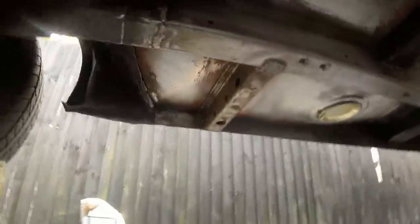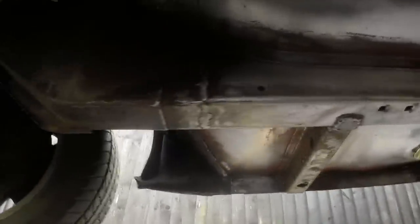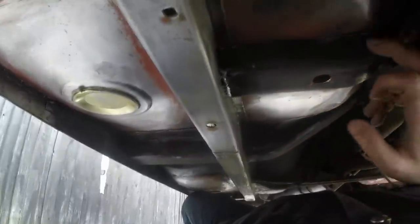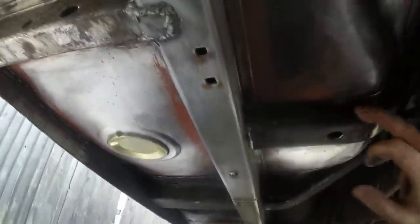Time for another quick tour. So that's what we have now - all sanded and keyed. I've been around with a hammer and closed up some of the seams. I'm not going mental because it's all gonna get seam-sealed anyway afterwards. So I'm gonna degrease it now, then get my mixture of paint and shove it on there. Hopefully we'll have a rust-free car for many years to come.